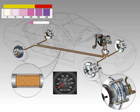The copper that coats the inside of the brake line is the first metal to corrode in the brake system. Copper test strips are used to determine the amount of copper ions in the brake fluid. Strips with no change in colour indicate little or no corrosion has taken place. Strips that change to a dark purple colour indicate the presence of a large amount of copper ions and that the corrosion inhibitors are completely depleted.